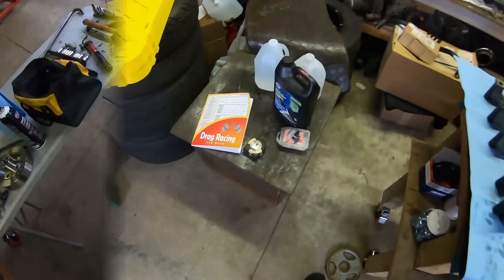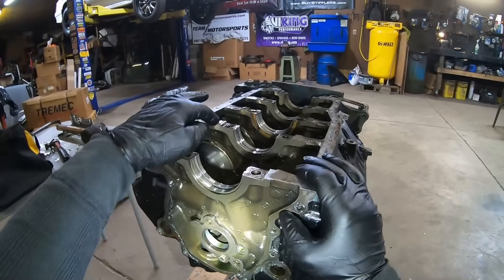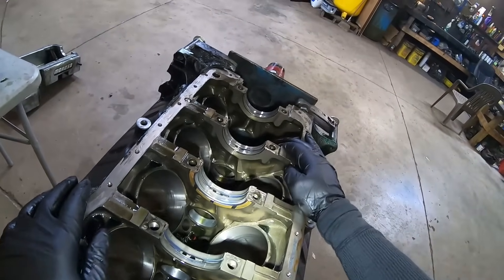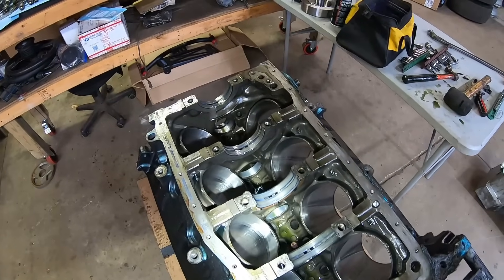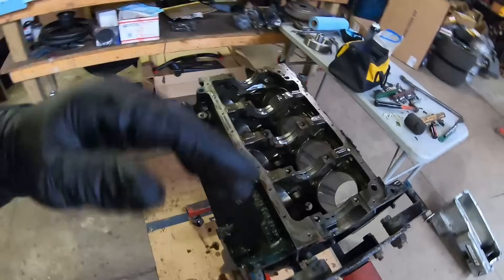What I wanted to do is take a peek inside the webbing on the block, because on 302s they like to split - I actually had a couple crack on my 302s. I wanted to check the webbing because this block has definitely seen a lot of power through it over the years. I'm not really seeing anything out of the ordinary. We still have to magnaflux it and check it, but it looks really good. I'm just impressed all the way around. This block's still good to rebuild, in my opinion. When built right, you can't tell me that a 351 Windsor production block can't hold power for long periods of time. Three and a half years, lots of passes at the track, street miles, E85 - which is a pretty corrosive fuel. That motor looks like you could just put it back together and run it.